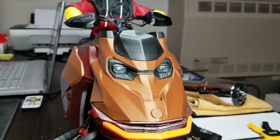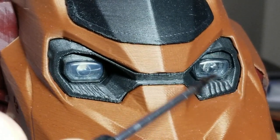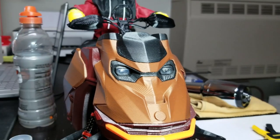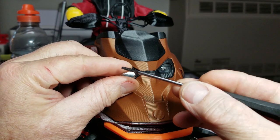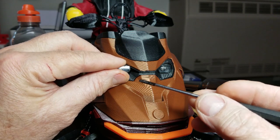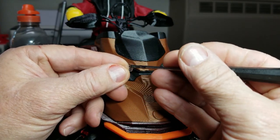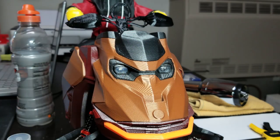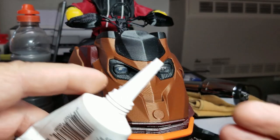The last part of this install: if you look closely at my headlight lenses, you can see a nice, neat, even bead of silicone caulk on the inside. This is to hold them in and also to keep moisture from getting inside and fogging them up. It would be very tempting to super glue these in — do not do that, because super glue will fog the lenses. So dry fit them, place them in, and take a small screwdriver. You might have to tuck the backside of the lens in as it has a slight bit of flare.